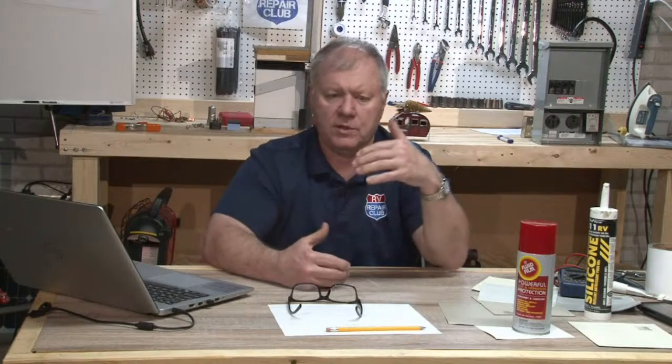And I typically don't recommend anybody put lots of water in the tanks, just because of weight distribution. It's 8.6 pounds per gallon. You could put 800 plus pounds in this stuff. But if you have too light of a front end and a heavier back end, and you have the weight to do it, you're not going over GVWR, you're not going over gross axle weight rating back there. But that's a big thing.